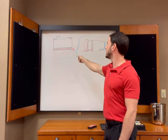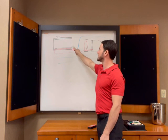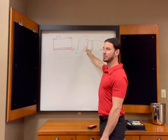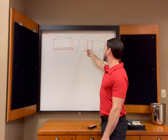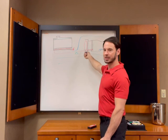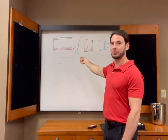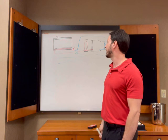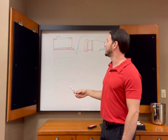I would not recommend anyone drive an SVX with a 92 radiator. I would not recommend anyone drive an SVX with a 92 torque converter. Now, if you have a 92 SVX, do I expect you to pull the trans and replace the converter? No, it's not viable. It should have been done under warranty, but at this point it's not viable. What do I suggest that you do?